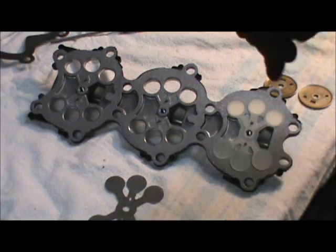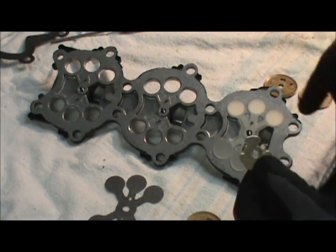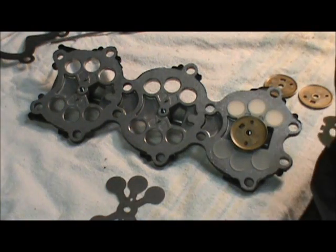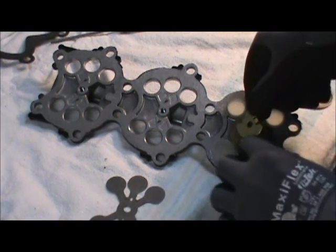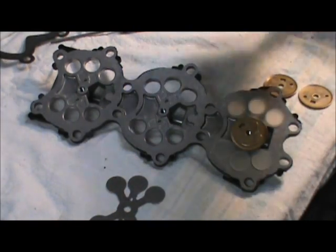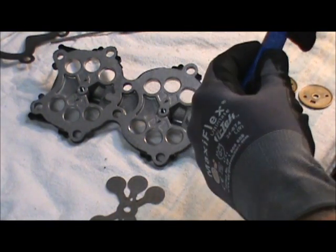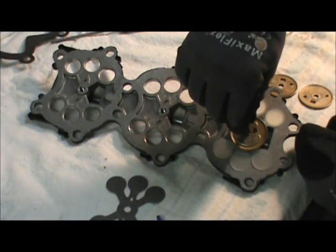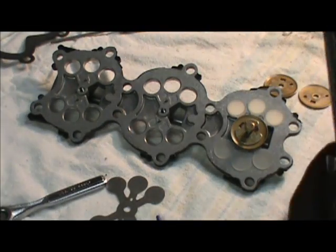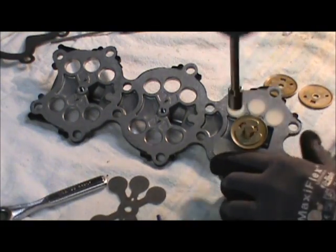Next, we have a two-piece washer. One is a washer with a little taper on it — it's a special washer. And then this is a locking washer — this tab will lock down on the head of your bolt. It also has holes for the pins. Then this washer goes on with a tab down into this little slot. Now we're going to take one of our bolts and apply some thread-locking compound on it — I use this stuff kind of liberal. Start the bolt into the hole.